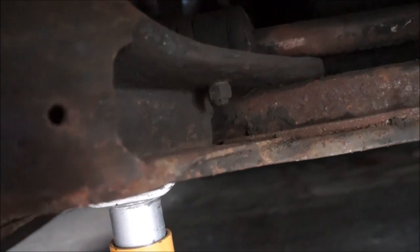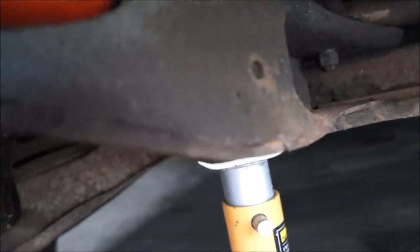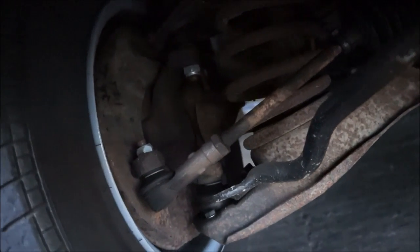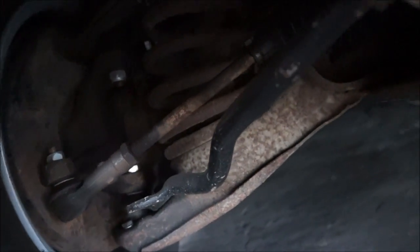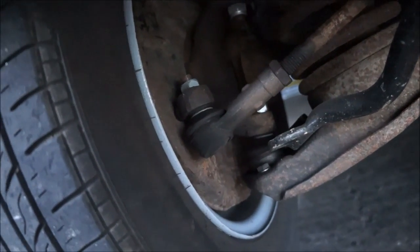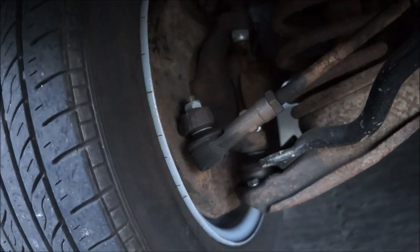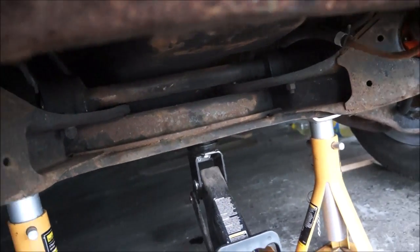Now, there's a bolt there, and you can see the bush and the U-shaped bracket there. And on the outside, there's another one, and there's one behind it as well. So when I get the wheels off, we've got to undo those on both sides. We don't need to remove tie rods, that's fine. Don't need to remove them at all. But these ball joints, they should come out quite nicely. They're brand new, of course. And we also need to disconnect the...